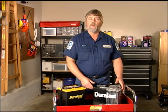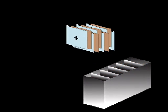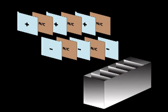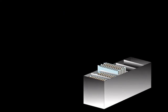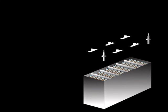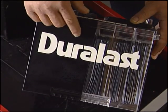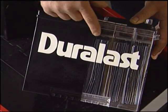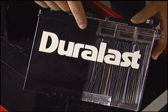Let's learn a little bit about batteries before checking the one on our vehicle. A 12-volt battery is made up of six cells, each producing about 2.1 volts. Each cell contains plates that are both positive and negative. Typically, the positive plates contain lead dioxide, while the negative plates are made from straight lead. The cells are inserted into a tough, non-conductive plastic case connected in series from positive to negative. The case is covered and then filled with electrolyte, which is made up of sulfuric acid and water. The electrolyte completes the circuit between the plates and makes the battery live.